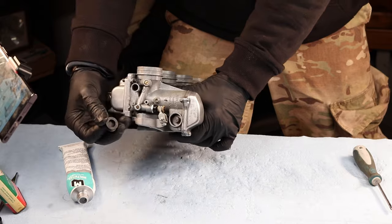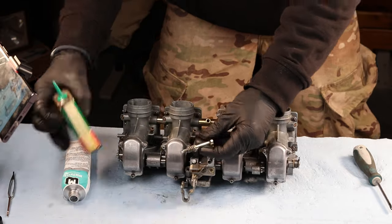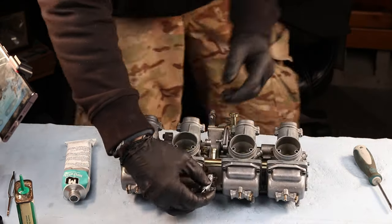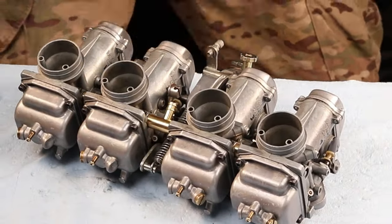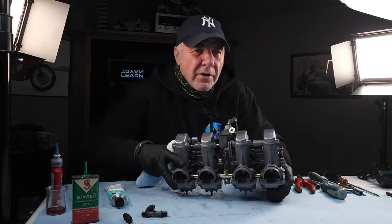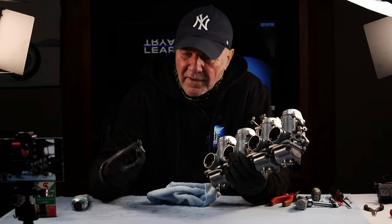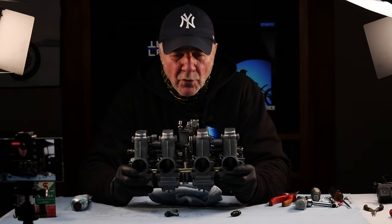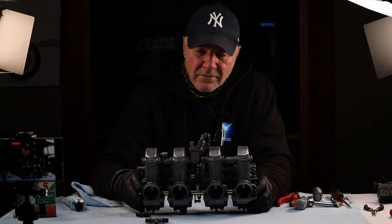There are these little rubber plugs that cover up the ends — sort of like dust caps, one on each side. Then there's the idle adjust screw. Lube that up — it's got a spring on it just to keep the tension. It screws in easily, nothing to that. Then you've got to feed in the throttle return spring. This thing is under a bit of tension — this is what gives your throttle the snap back when you let it go. Looking pretty good. We managed to get this puzzle put back together and we don't have any parts left over, other than the parts we replaced. Seems to function okay. We're one step closer to getting the old GS750 back on the road. It hasn't been without its obstacles, but I've made a few videos about it along the way — you might want to check one of those out.